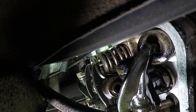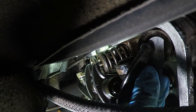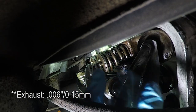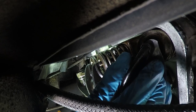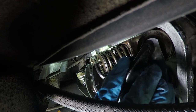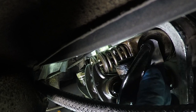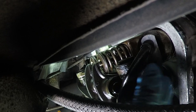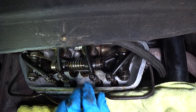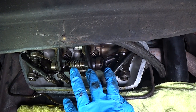The exhaust on the right can be a little difficult to get to — easiest to approach from the outside and slip the feeler gauge in. This is the 0.006 gauge, slightly bigger. We're feeling just about the right friction. You don't want it so loose that it'll fall out on its own, but it should stay in by itself. You want a little bit of friction but you shouldn't have to wiggle it back and forth — it should go in and out just nicely. Those are great, so I'm going to leave those exactly where they are. That's it for cylinder number four.